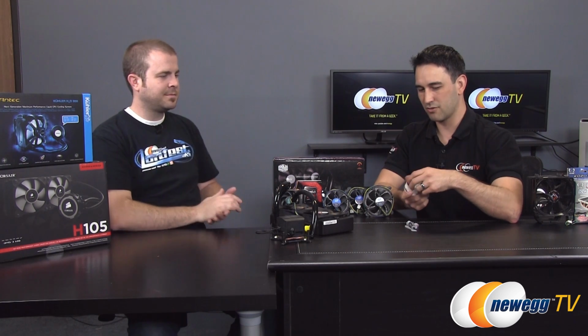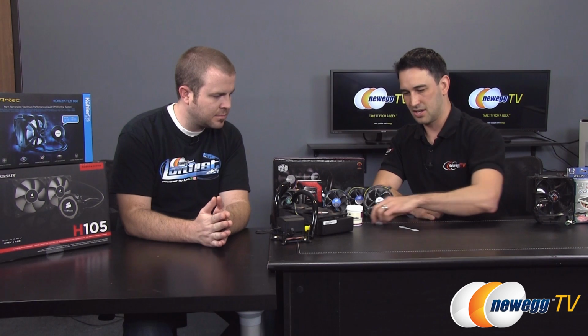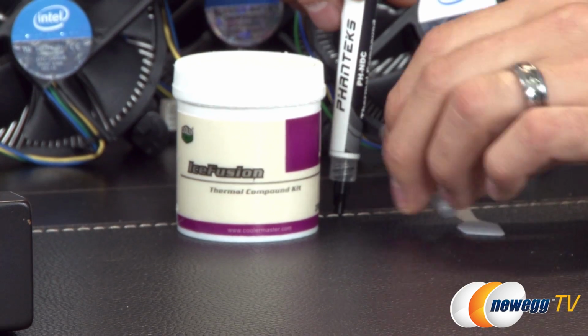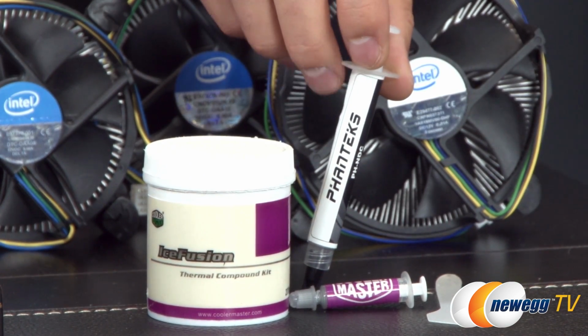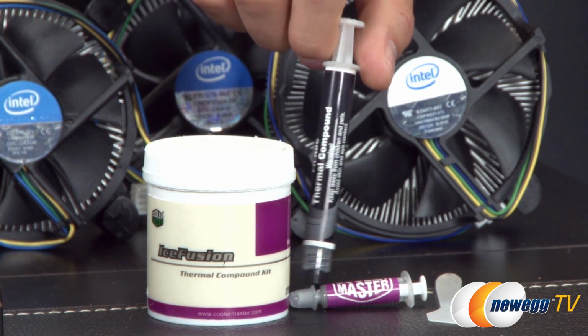One last thing I noticed that we haven't talked too much about, but we mentioned slightly, was thermal pastes. And I guess you'd want to mention a little bit about this before we move forward, right? Yeah, that's right, Steve. I kind of brought it out here just as a reminder because that's something that you don't always consider when you're switching from one cooler to another, is that you do need thermal paste. Now, fortunately, most of these aftermarket coolers will recognize that. So pretty much every single one that I'm looking at here will come with its own little tube of thermal paste.